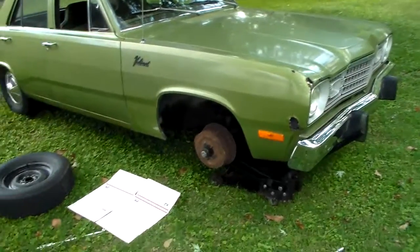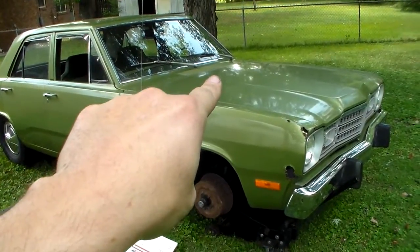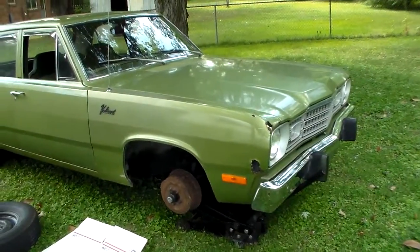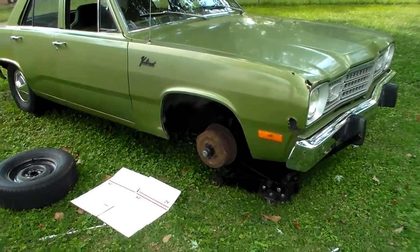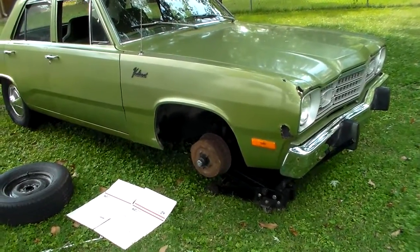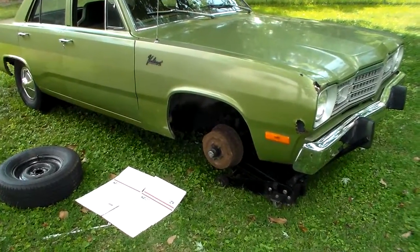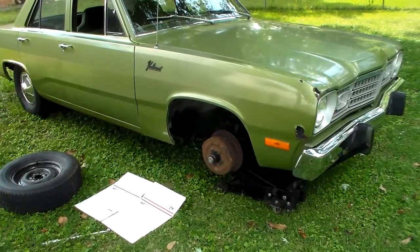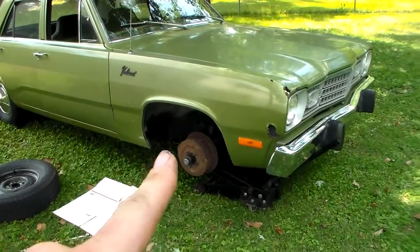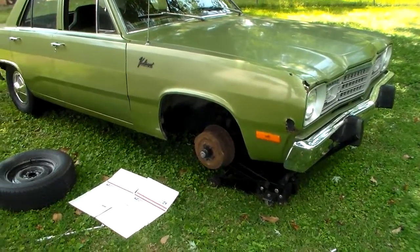If the brake out here is not working, even though that one and that one and that one are working, people will say, oh, maybe it's the master cylinder. No, that's not where you start. Don't do your diagnostics like that — it gets you into a lot of unnecessary money, expense, and work. Whenever I hear somebody say 'I'm thinking it could be this or that,' I say you need to take the thinking part out and put guessing. You're guessing. So let's dig into this right front brake and see if we can determine what our problem is.